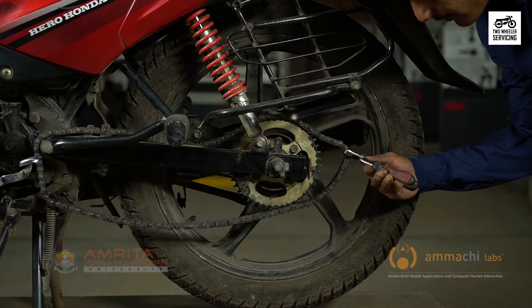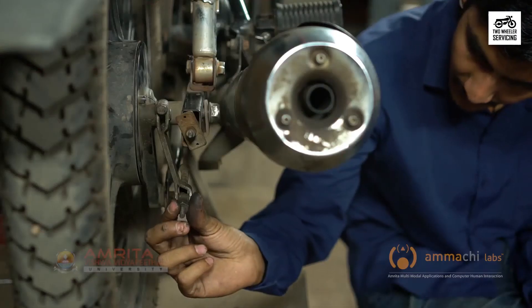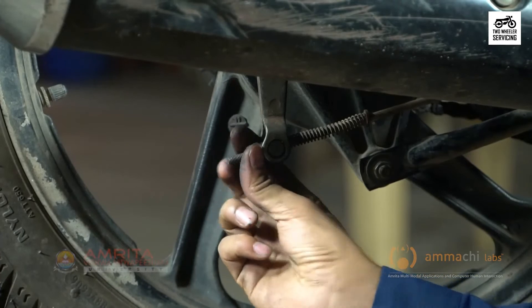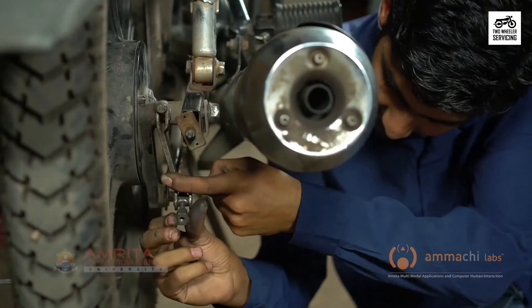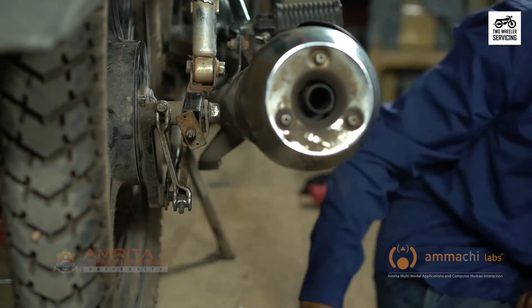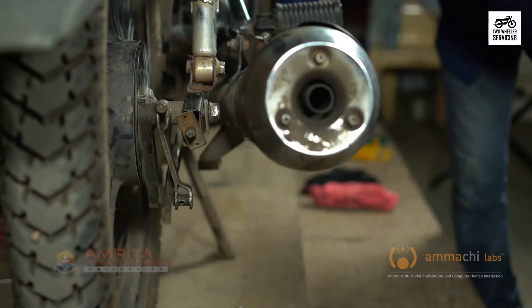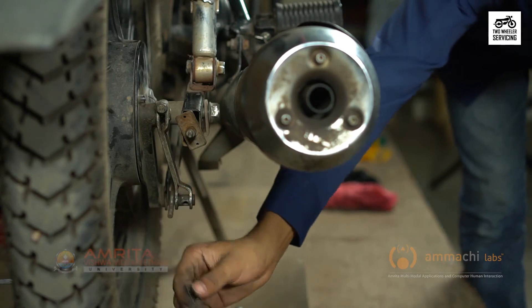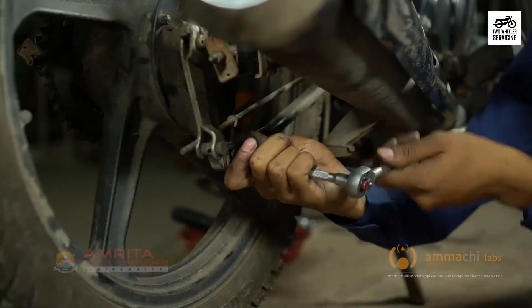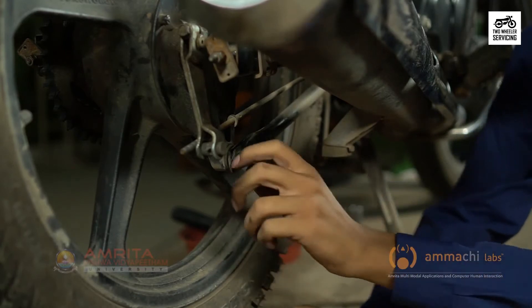Remove the chain from the rear sprocket — it can hang down loose. Now disconnect the rear brake cable from the brake and the drum stabilizer nut. The cable tensioner can be unscrewed by hand. Once the adjuster nut has come off, push down the rear brake lever — this withdraws the cable from the cable holder on the brake drum. Gently move it to either side away from the holder. Next, remove the nut and washer on the brake drum stabilizer and place them in the parts tray.